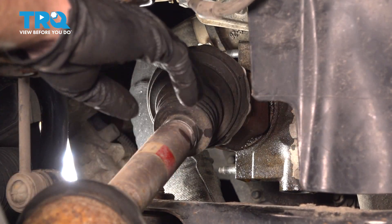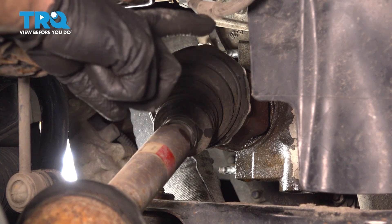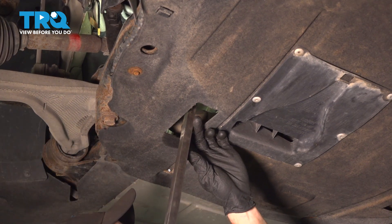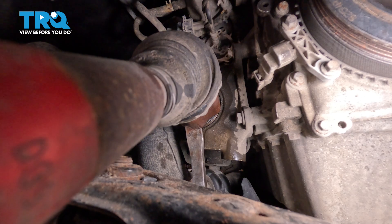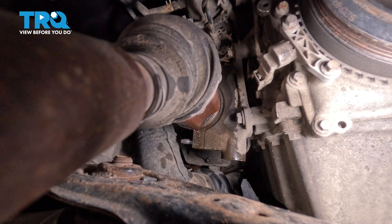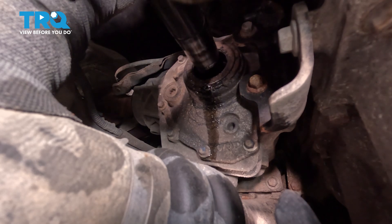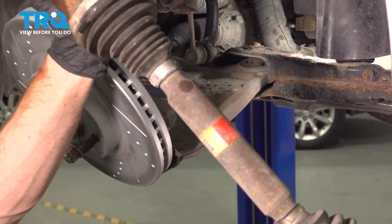Continuing from here, you'd want to try to take hold of the axle and pull it out, but typically it's not going to be able to slide out of there — you will have to gently pry it. If that's the case, you're going to have to make your way safely under the front of the vehicle. From in the shield, you're going to find that you have a rectangular hole. We'll use a pry bar straight up in this area, looking for the axle in the bracket. We're pressing directly up against that axle in the bracket and gently prying to try to separate this. Let's take hold of that axle and start pulling it out of here. There it is.